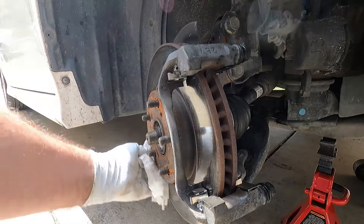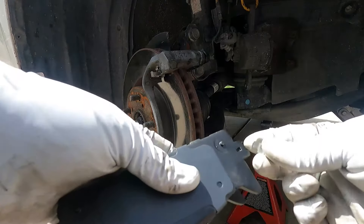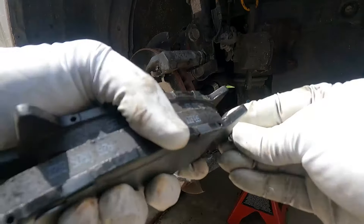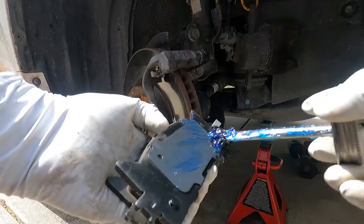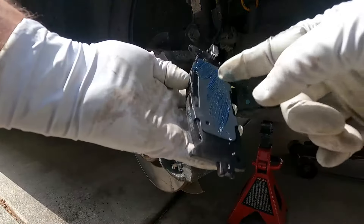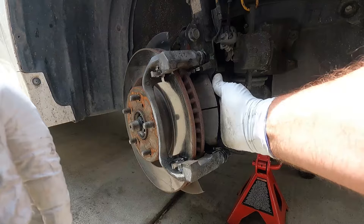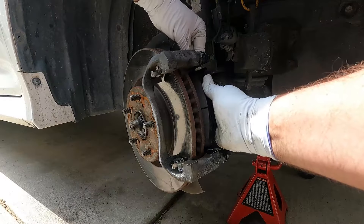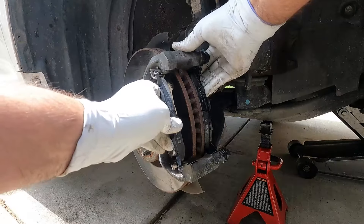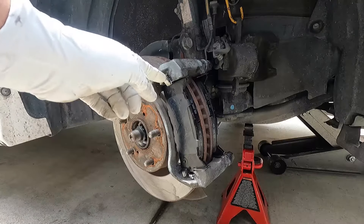I'm using this little pry tool to press those in place — easier than your fingers. I got a little bit of that caliper grease on the rotor so I'm just wiping that off. These little clips are springs; they go on the top of the pad. They have little recesses on each pad — just line that up and snap those into place. I also like to put just a thin layer of grease on the back of the pads. I know the pads get really hot and a lot of this will melt off, but it does seem to help dampen the vibrations that cause noise. Install the pads at a little bit of an angle — almost easier to start with the bottom and then push the little spring in at the top.